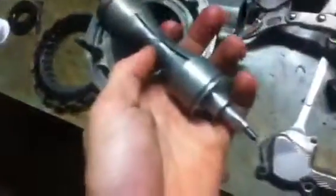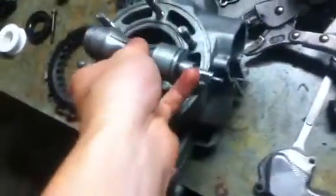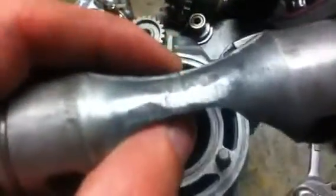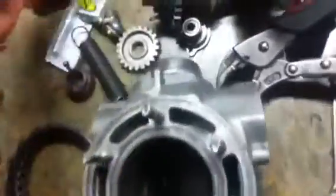I modified this standard power valve to fit a 40 overbore. If you actually take a look right here, there's a few grind marks — just real little ones — they're going to get smoothed out.